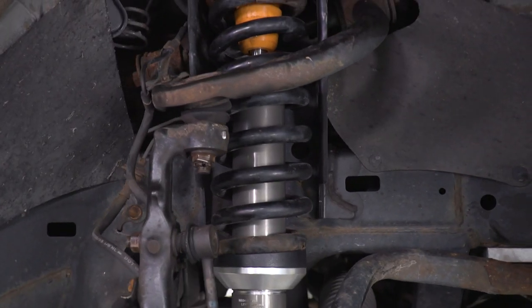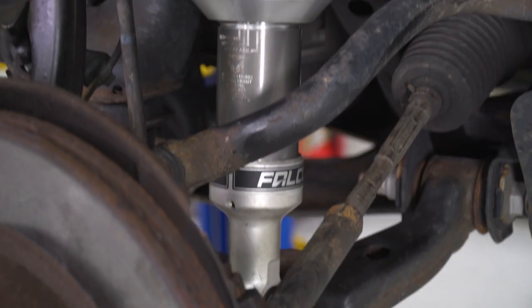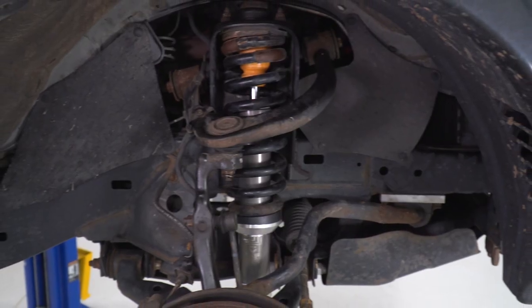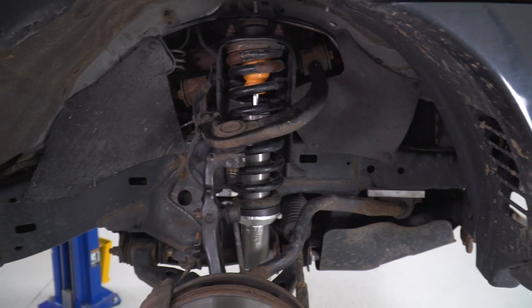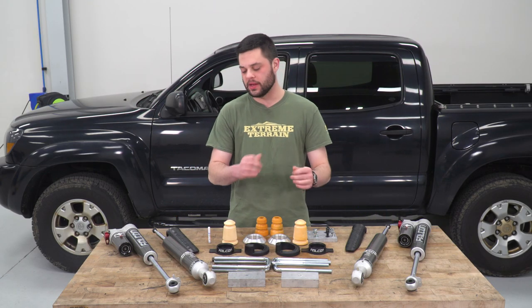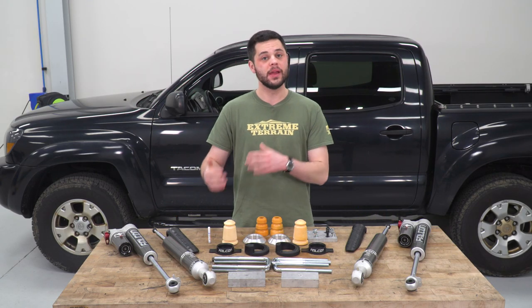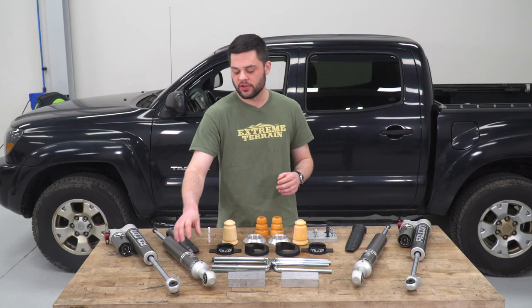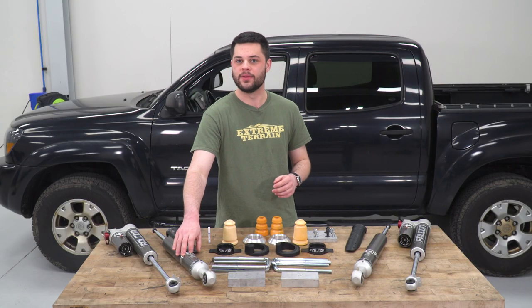6061 aluminum body that's also a lot bigger in diameter. That's gonna help contribute to the cooling capacity as well, as there's more fluid actually in the strut. Hardened steel shaft, that's gonna be great for durability. And speaking about longevity, at the bottom here, we also have some Zerk fittings, allowing you to keep those nice and lubricated if need be.